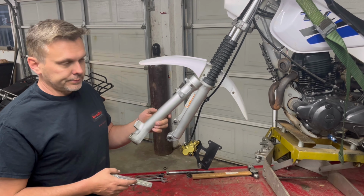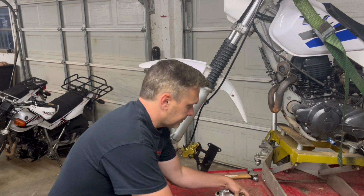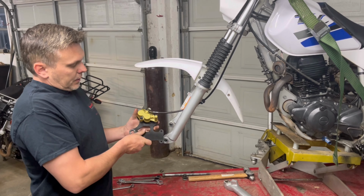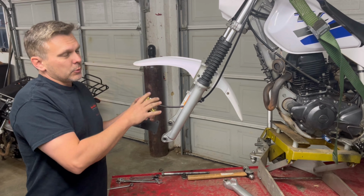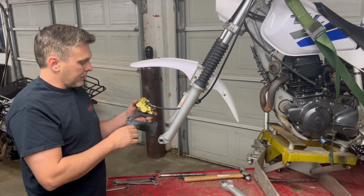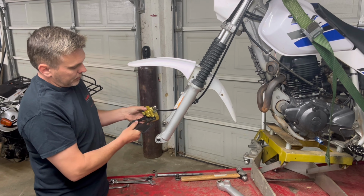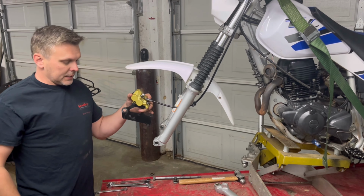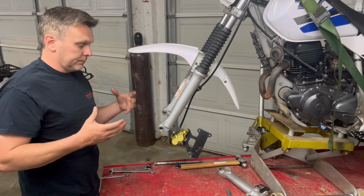Once that is cut, everything just kind of falls on like a normal simple disc brake. There's not much to it. This will come partially assembled, like I try to do. I try to at least get it together for you. This one won't be pre-bled. You'll need to do a little bleeding afterwards, but you'll have your caliper bracket slid into the caliper. Brake pads are in there. It'll basically look just like so. And this part will now go here, and then the wheel will go back in once the disc is on, and the hub. Let me show you how to put the hub in the disc, and we'll be ready to go back together.